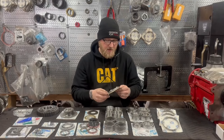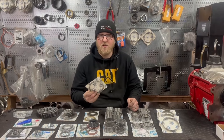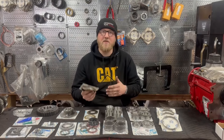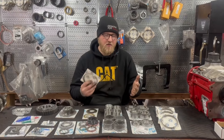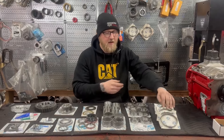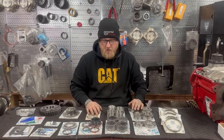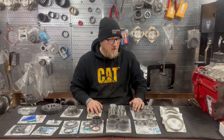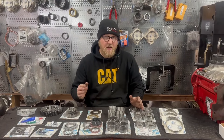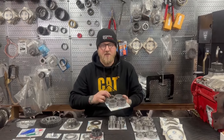Speaking with Jesse, I do believe that brass synchronizers will be an option. Brass are great — super long lasting — and you can pair those with Pennzoil Synchromesh for an equivalently good shift out of those. They'll last a very long time and they're a really good quality friction material. I think that's going to be a drop-down option, but we're not quite sure yet. We'll have to see when it goes live as to how that rolls out.